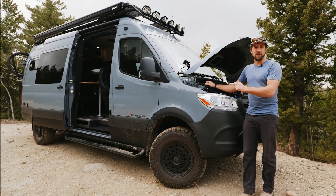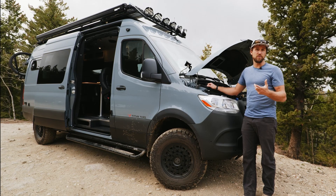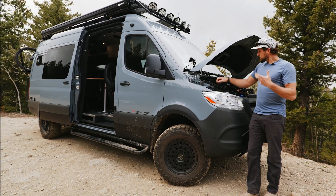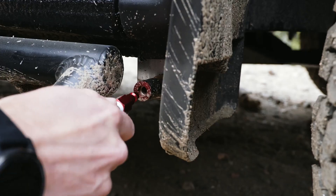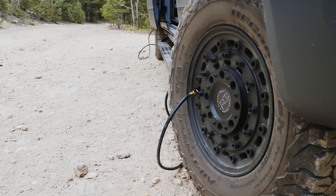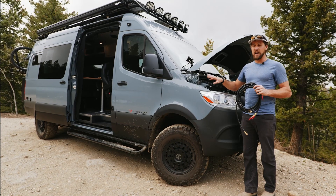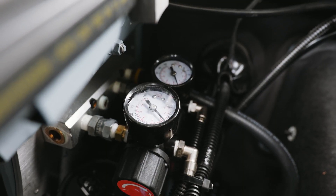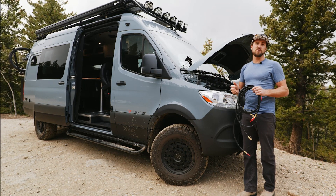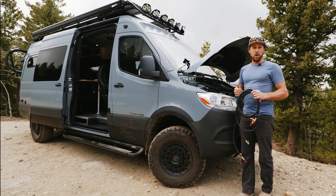Once you see your pressure is where you want it, stop and take the deflators off. It's best not to leave them on since a small air leak could give you a flat tire. After you're done driving trails and get back to pavement, you'll need to air back up. With our kit we include four air lines — one at each tire — and when you flip the switch you'll automatically air up your front and rear tires simultaneously but to different pressures based on how you set your regulators. We timed going from 35 psi on all four tires back up to 65–75 and it took only nine minutes. This kit takes all the hassle out of airing down and back up.